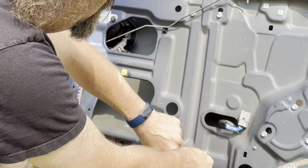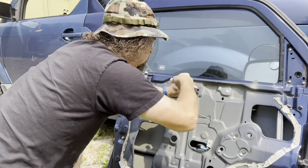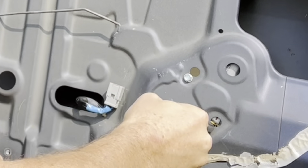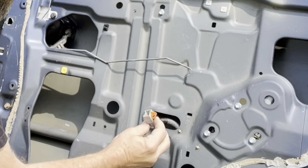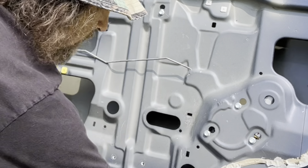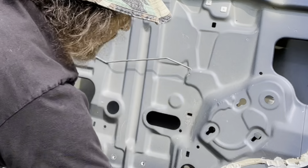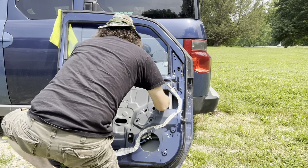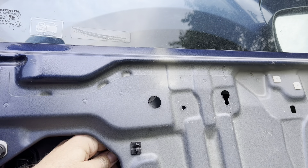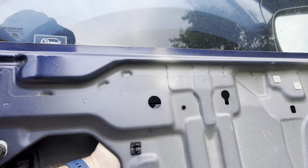I don't have a lot of time today. I'm using this one and this one. These three are for the motor. Put that plug off — that plug. There's all those loose. There's a bolt back in there and back in there that actually bolt the track to the window, and those have to come off. So let's get our little 10 millimeter ratchet in there.